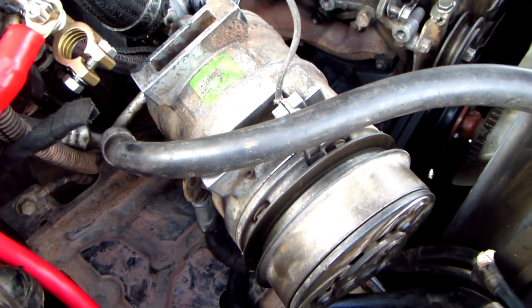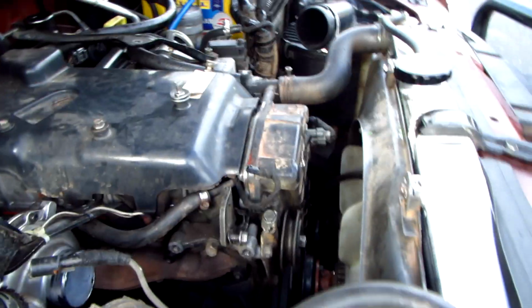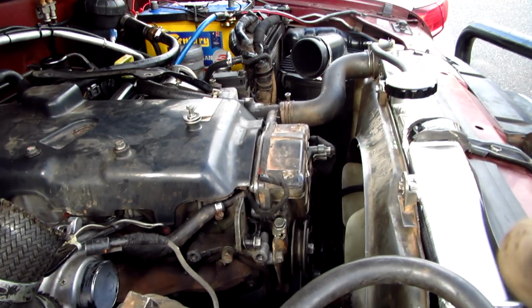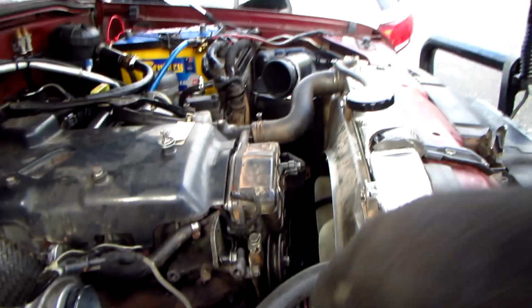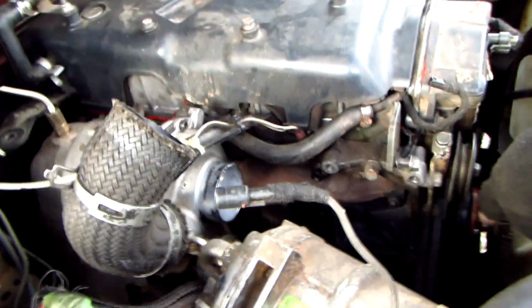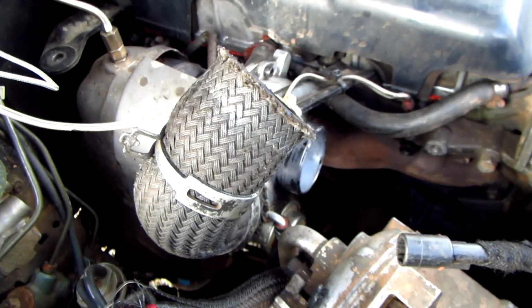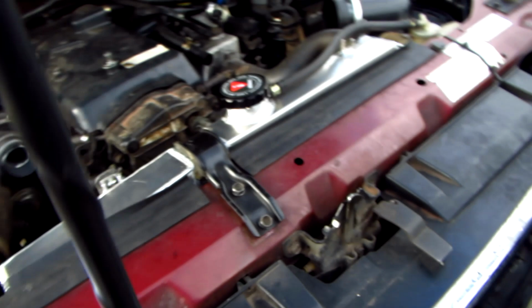All right, everybody, I've got the air conditioning pump off. It's set aside, I've disconnected the earth leads, and there are three options here. The engine's either locked because the compressor was seized and it isn't, or the pulley and that isn't, or the water pump seized. I've got the belt slack, and I can't turn the water pump. So I'm hoping, among all things, that the water pump has seized.